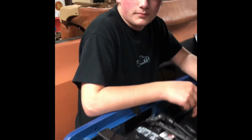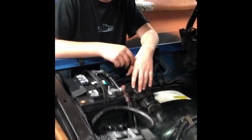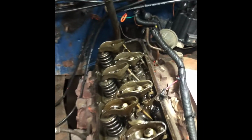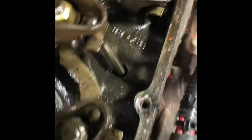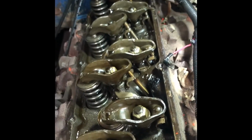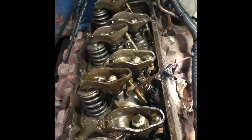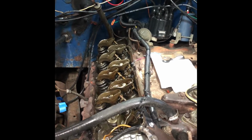So, what did we just say? Well, it's not in there, so it must have just pulled out something. There's not metal shavings in there. And well, metal shavings, is it not clanking around? It could be, and also it's hitting it right there. It makes sense. Yeah, but the magnet on the bottom off some shavings at that spot, so the magnet on the bottom would definitely hit it, but yeah, that's a new one on me. So guess we're gonna order up a push rod and see.